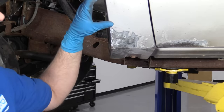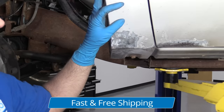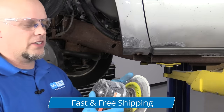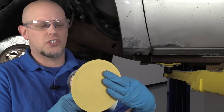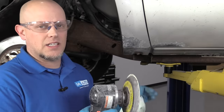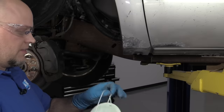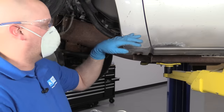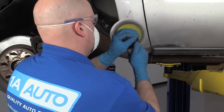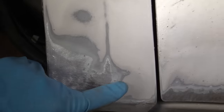At this point I could grind this down a little bit more and actually use some fiberglass body filler, but in this case I'm just going to try to smooth this down a little more and just prime it and then paint it. The next tool I'm going to use is a DA sander — a dual action sander — which means the pad doesn't actually spin. It more just oscillates, which is pretty safe and makes it easy to get a nice finish. I'm going to use 220 grit paper and make sure I wear a mask and safety glasses. What I'm trying to do is just feather this out a little bit so there's not such a hard edge from the old paint. So here's the raw metal, feathered out so it's not such a hard, sharp paint line.